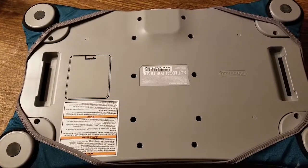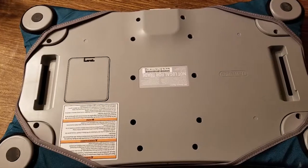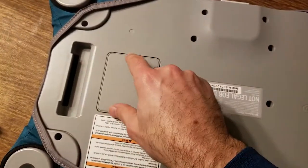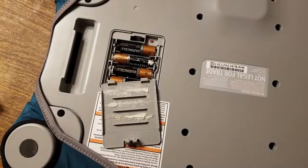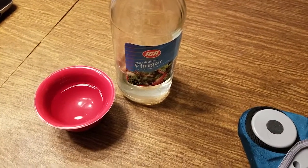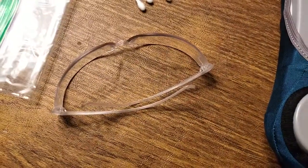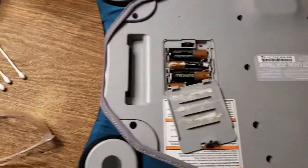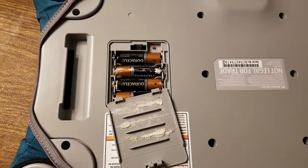And you need to clean that up. So how do we do that? That's what we're going to go through in this video. So this is our patient — this is a Nintendo Wii Fit balance board. It's an older model, I know, but it still gets used and it hadn't been used in a little while. One of the kids went to go use it and it didn't work. So to do this cleaning operation, I've got a 50-50 mix of water and white vinegar, some cotton swabs, some eye protection, and I didn't have any white rubber gloves so I figured maybe a plastic bag may work as well, just so that my hands don't come in direct contact with this potassium hydroxide salt that's remnants here.